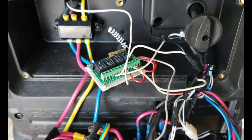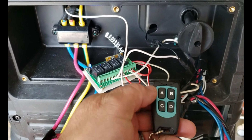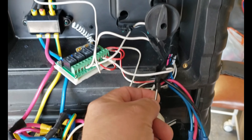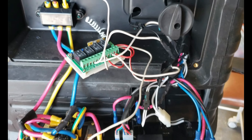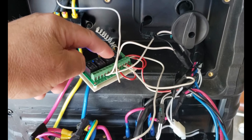For the ground of the main board I just connect to one of the two panel grounds here. Since I need power to the first two relays, I run a jumper from the positive of the board going to the first relay B terminal, and from the first relay B terminal to the second relay B terminal. So both relays are powered with the 12 volts coming from the white wire tap.